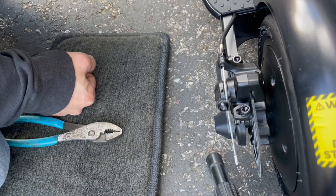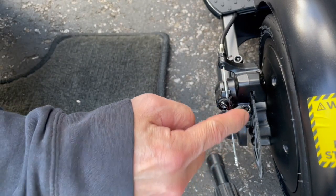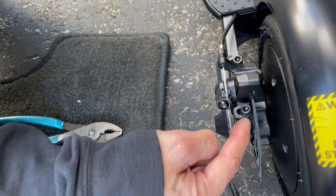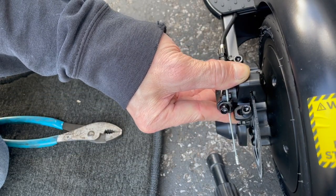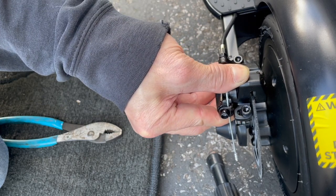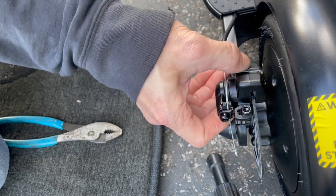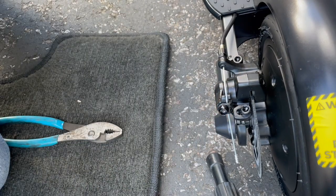You see that? The rotor doesn't flex at all. So from there I look at the relation of my bolts to the caliper mounting spot. I'm going to release the brakes a little bit and push those brakes inwards a little bit — just give me that little bit of slack so that way it doesn't rub.